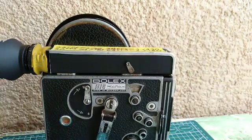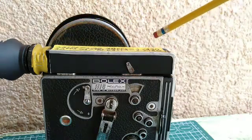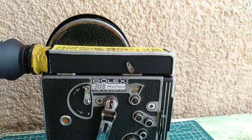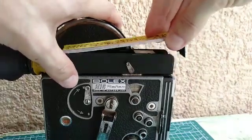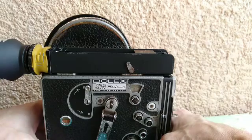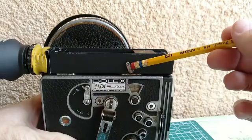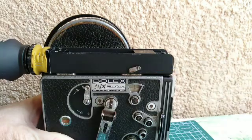First, there would be 4 micro screws on the top of the viewfinder. You would have to unscrew that with a micro screwdriver. As many of you know on my channel, I leave mine open for students and anyone interested in the Bolex operations. So you just remove those 4 screws. You want to take this knob, this lever, and flip it up, forward, just like that. Alright,